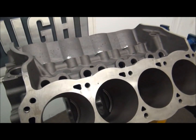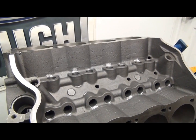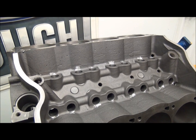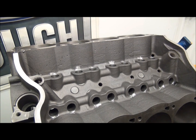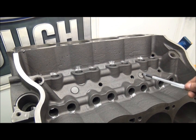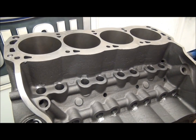The first big difference is in the lifter valley here. There is a crossover here and the regular crossover — you can tap those to restrict oil going upstairs and so forth. But the biggest thing you'll notice is that it does have this raised portion that's not drilled and tapped for a spider, for the spider tray for a dog bone setup.